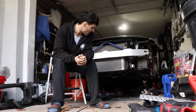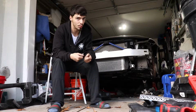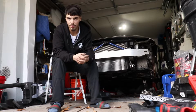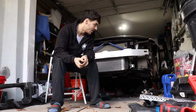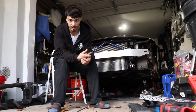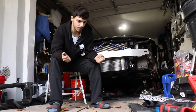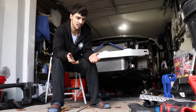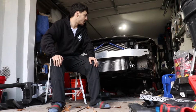It's a slow leak. I threw cardboard under the car before it sat, so I can see where we're at with everything, and that's how I found out one of my oil cooler lines went bad. It was actually the O-ring in the line, and I didn't really need to replace the line. I could have just replaced the O-ring, and I didn't know until I bought a new thermostat. I replaced the line, forgot to put the O-ring in, threw the thermostat in, and I'm like, what the heck? I threw the O-ring in, and it's good. Excuse my French, I'm sorry. It's just where it gets with these cars, man. So I'm having those issues.